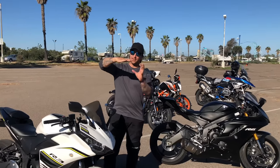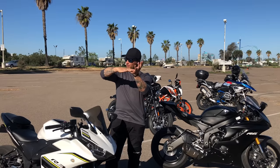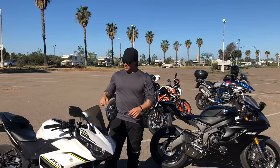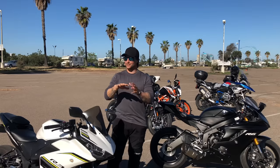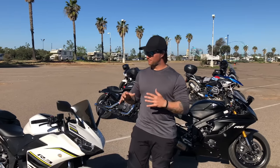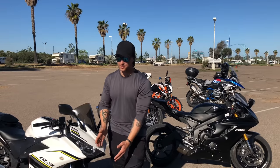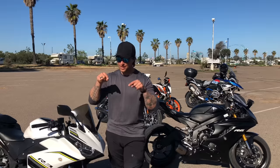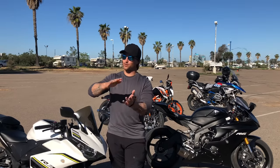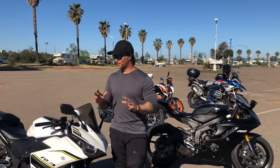Here's the bike — you've got the tire. If you hit a bump, the suspension compresses. After you go over the bump, it rebounds — it goes up and then back down. How fast it rebounds greatly affects how the bike handles, because the main job of the suspension is keeping the tires pushed down to the ground and maintaining traction. If it's not adjustable, it's just going to be too squishy and bouncy.